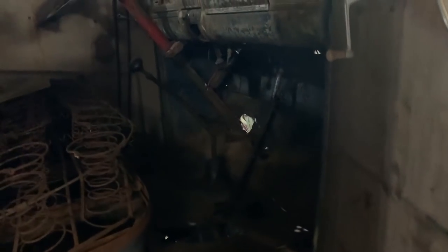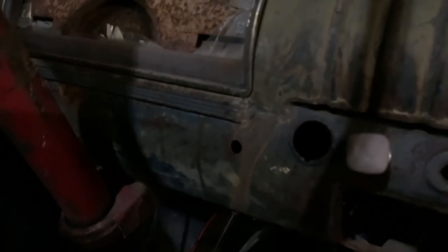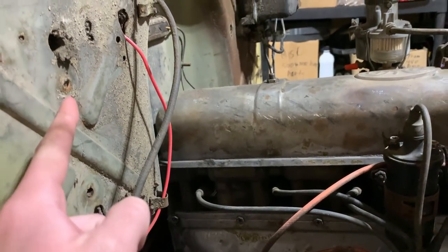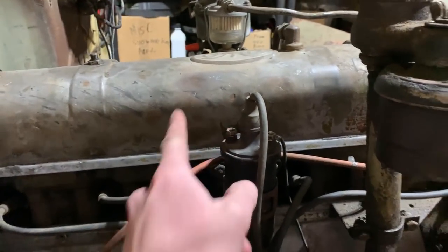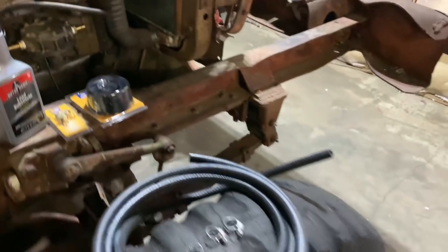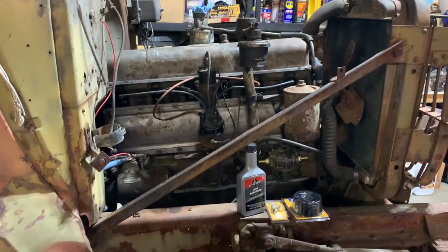And then after the fuel line is done, wire in that switch somewhere, probably that hole there, that smaller one. Got to run the power wire into the switch, and then on the other terminal, run the wire out to the coil, which is, you know, pretty straightforward. So let me get this stuff knocked out, and we'll check back in, throw a battery in this thing, and see how it cranks over with these nice cables.